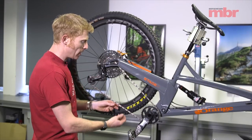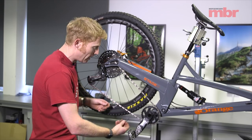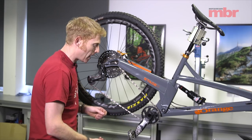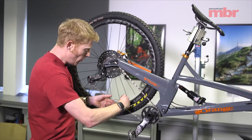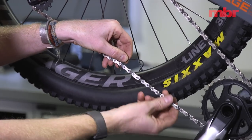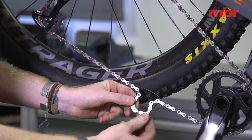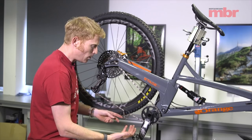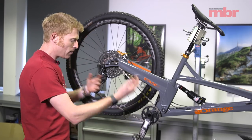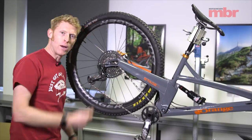Trying to remove your chain or get rid of the quick link when the chain is under tension can be tricky, especially when trying to join it back up. But using your little chain hook, all you want to do is hook it into one side, pull the chain nice and slack, hook it into the other side, and then you've got free access to the link you require. Super easy — once it's all ready, simply pop it off and away you go.